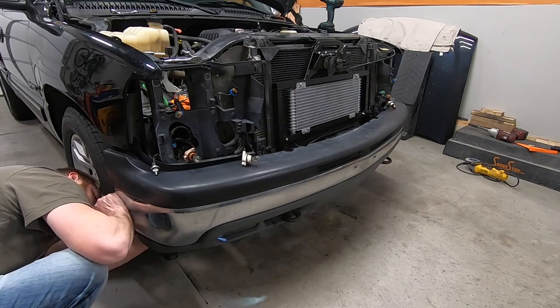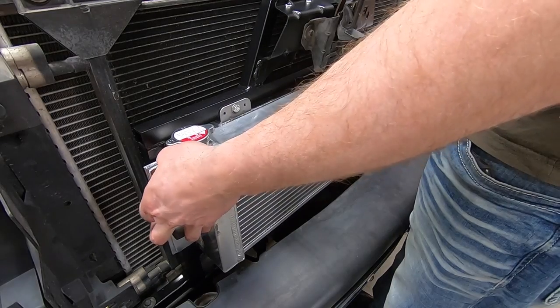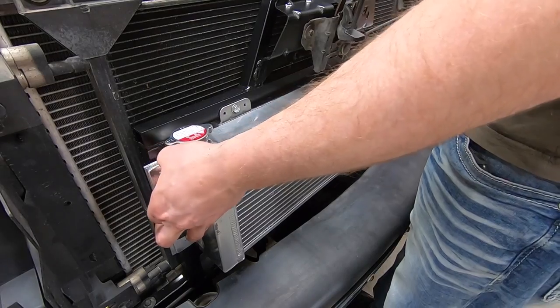Three differences, maybe. The one big difference is the trans cooler is on this truck, kind of hidden behind my heat exchanger for the supercharger. So airflow is probably a little bit obstructed compared to the ugly truck, where I do have an intercooler in front of it, but it's spaced further ahead and there's more room for air to get through it. So there's that.